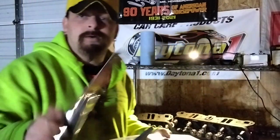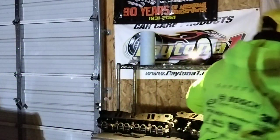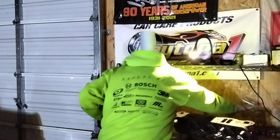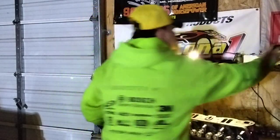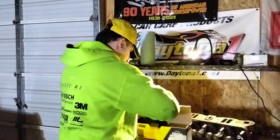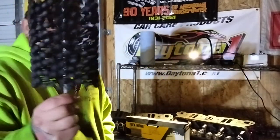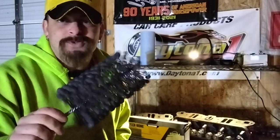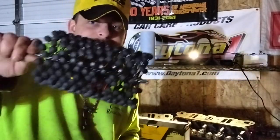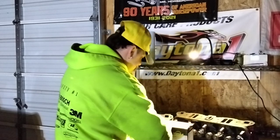I've got to stock up on more stones — I've already gone through four, but I've had this tool for three years. These are around $30–$40 on the shelf depending on your state. When it comes to getting a good crosshatch and a good polish, I use my dingle ball hone by BRM — Brush Research Manufacturing. And if you understand the old school reason why some guys call them dingle ball hones, think about it for a minute — but dingle ball hone is just easier to say and it makes a lot of sense. It's kind of the old-school way.